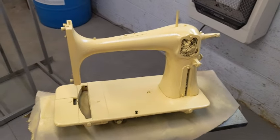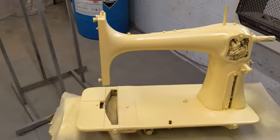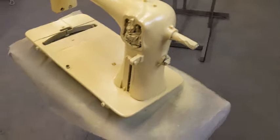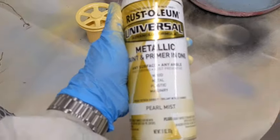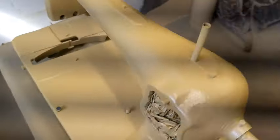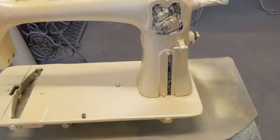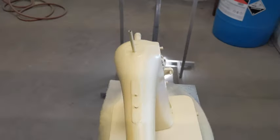Before I start with the color coat, I will come back with my clean microfiber and wipe her down one more time. So at this point I have the color on. Basically what I do is give a light dusting of color first, then come back immediately and let that flash dry real quick, and then give it a nice good coat. I've given her a really good solid coat of the yellow — her and all of her pieces. Now I'm going to let that dry for about 15 minutes and then come back and give a nice good coat of the pearl.